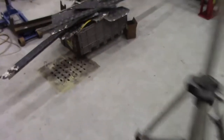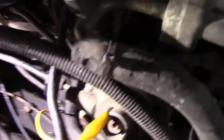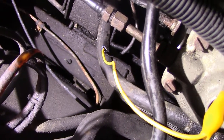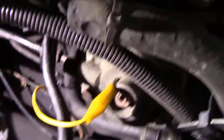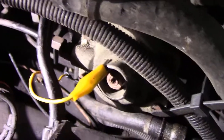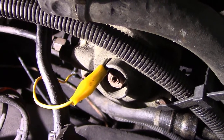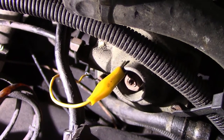To test that, I rigged up a jumper lead again. You can see that yellow lead - it has a connector that goes down to the bottom and connects onto your oil pressure warning light lead, then goes straight to ground. The oil pressure switch works through a ground, so this actually bypasses the switch and shows me that the rest of the circuit is intact - meaning it's actually the switch that's at fault.